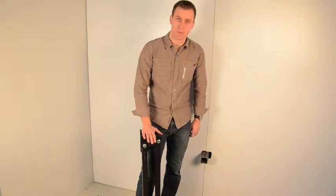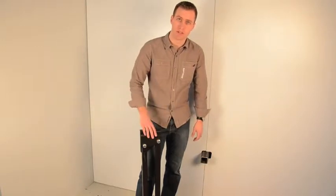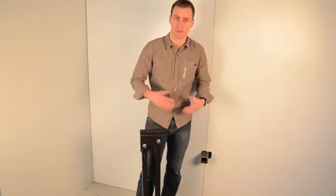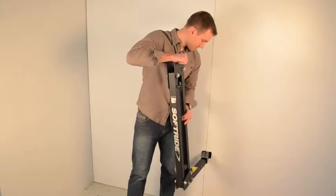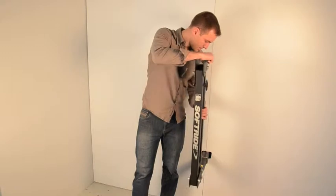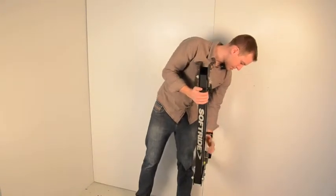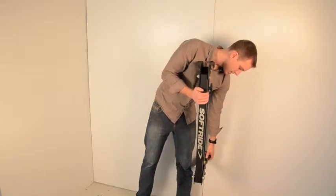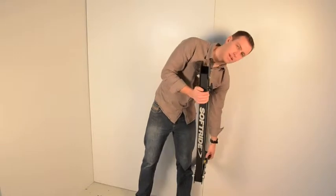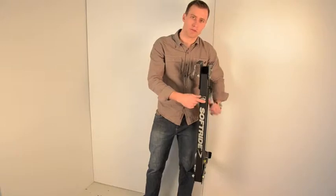We're going to install our main rack assembly for our Hang 5 bike rack into our receiver hitch. Imagine that this is on the back of your vehicle. It will provide a stable platform for you to build up the rest of your rack. We'll move that in until we're able to line up the hitch bolt with the bolt hole in the rack. Once we've got it lined up, we'll locate our hitch bolt and attach it to the receiver hitch.